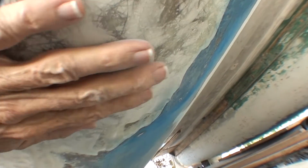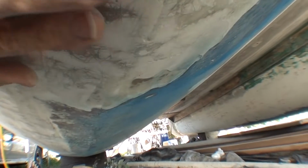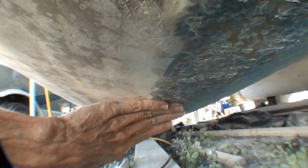that actually went around the bottom a bit. And I filled it with a bunch of layers of chopped strand. You know, tabbed it out a bit. And that's what I'll do here. You know, I'll grind back, probably, since it's on the bottom, probably 8 inches.